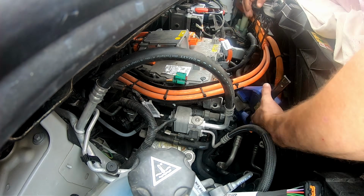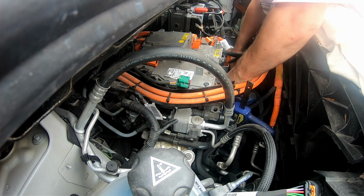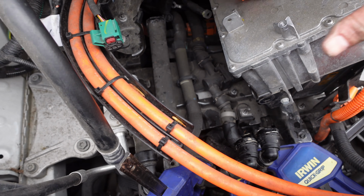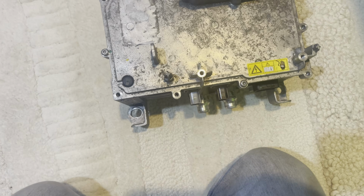You're going to want to clamp these, and it is very important. This whole coolant loop travels around the battery, the motor and the inverter. If we leave these open, we're going to get air into the system, which would then require vacuum bleeding to avoid air pockets. Some DIYers might have this, others not. Something as simple as having air pockets in the motor or in the battery is enough to brick a vehicle. This is all avoided with 2 clamps. I used woodworking clamps. They were less than ideal because they're pretty bulky, but they did the job.